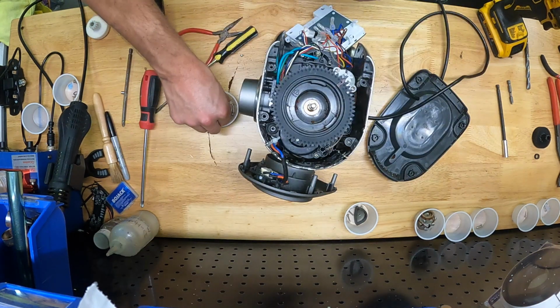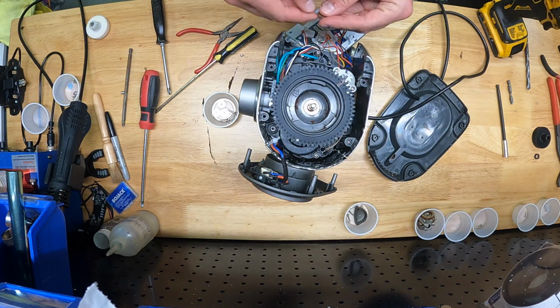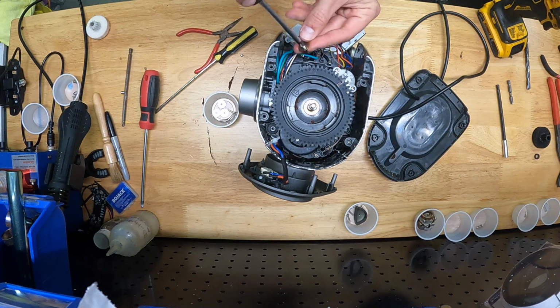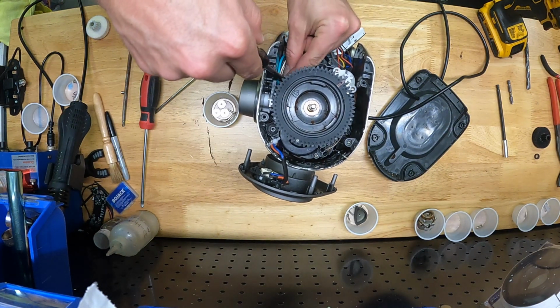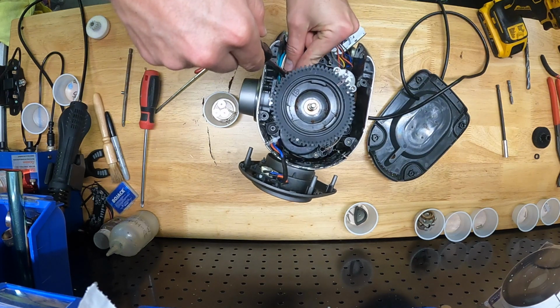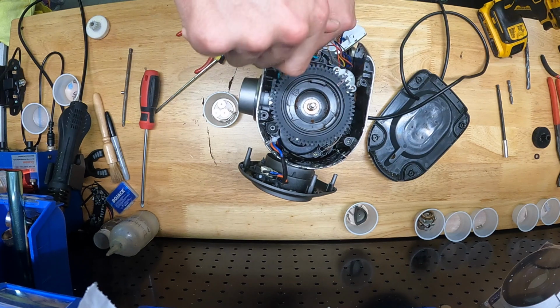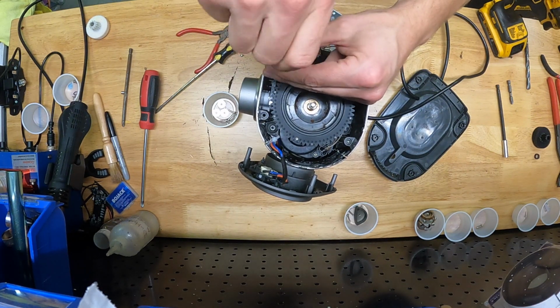So, all right, then once you have the gearbox on its pads and you go to put the screws in on the top of the gearbox to hold it in, those 4 screws, there's a Phillips head screw there, and you see that little flat washer. That's the one with the smaller ID that goes on the top. Again, another pro tip, I would probably put those washers onto the gearbox first, and then put a little dab of super glue or something just to hold them in place.